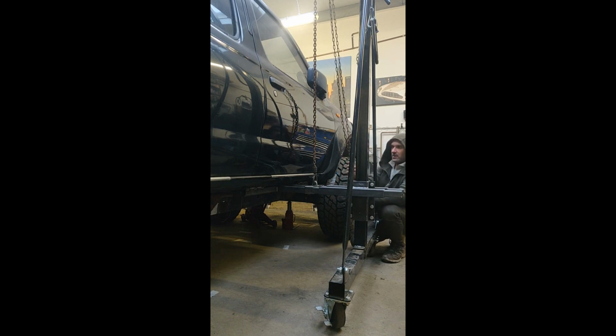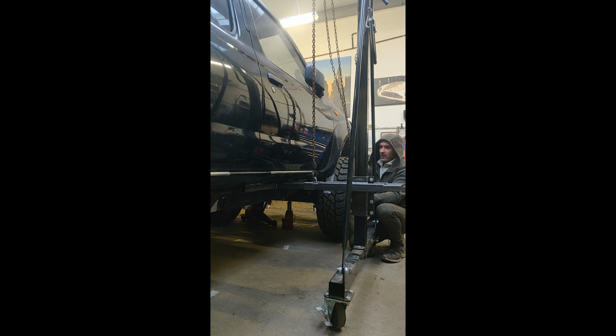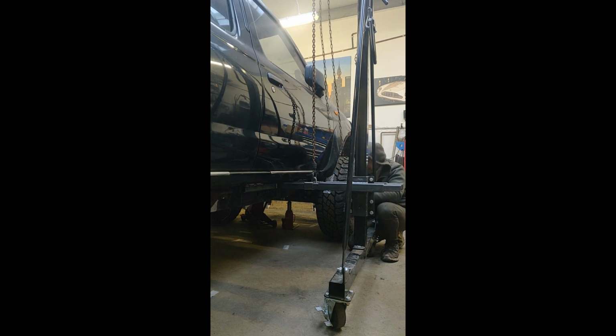The chassis is still bolted, but you can see us lifting the whole Jeep. Simple as that. I mean, this tackle box has a capacity of a ton, and the other box is 2 tons, but the gantry crane is a ton, so I can lift a ton and a half, so I can lift a ton safe. Between the two tackle boxes, that's half a ton each, and this chassis is less than a ton, so it's not so heavy. I'm quite happy with the result.